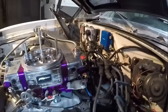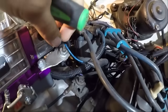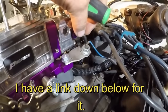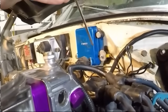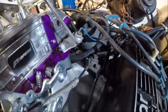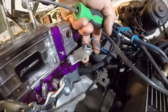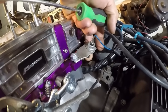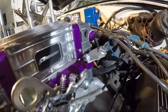Then I took a ground wire tied to here and ran it over to a hood switch. Right now it's grounded, and when it's grounded the voltage regulator is grounded and the alternator charges. As soon as I open the throttle to full throttle, if I turn this thing upside down — which is the way it will be — the throttle comes up and hits the bottom side of this and pushes it up. Once it's pushed up, you lose your ground, your alternator quits charging and quits robbing your horsepower all the way down the track. When you get to the end of the track, you let off the throttle, alternator's charging again. It's simple. It actually works and anyone can do it.